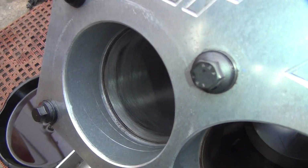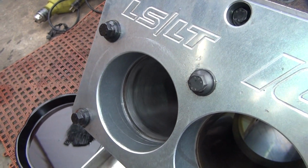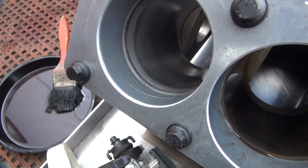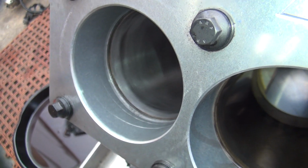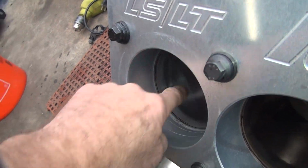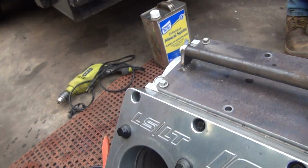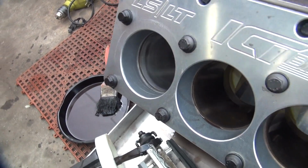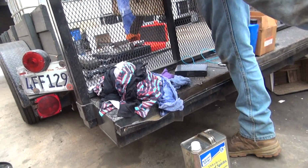Okay, that's a pretty coarse stone. See the finish it leaves? Yeah, that's the finish stone. Okay, it appears my crosshatch is for a high RPM short stroke motor. Is that what this is? This is a very low crosshatch, medium RPM high boost motor. Oh, okay. So we might have to do a little faster stroking. Where's your bore gauge that we set up real nice?